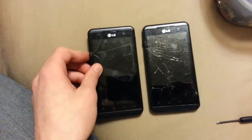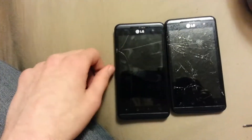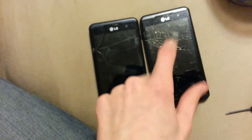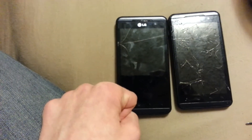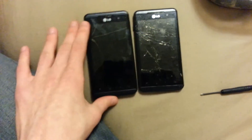The seller said that they did work, but they needed their screens replaced. One of them the touch doesn't respond, and one of them it just looks cracked. I'm assuming this is the one that looks cracked, and this is the one that has the unresponsive digitizer — because the digitizer is a thin layer of glass that senses your touch, glued to the actual screen itself. They're stuck together with epoxy, and as you can see, the epoxy is coming undone in a webbing form on the screen.